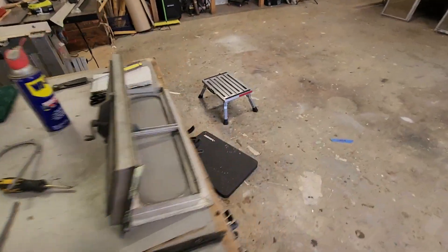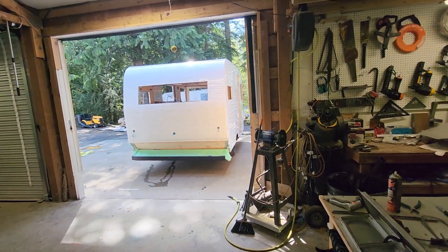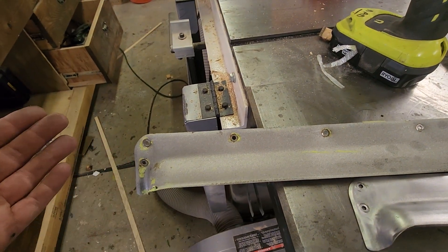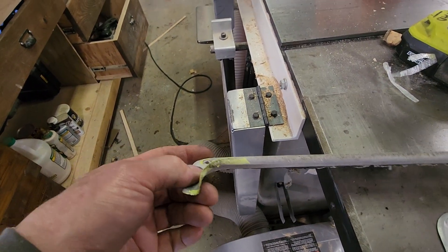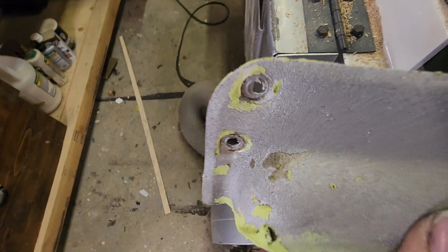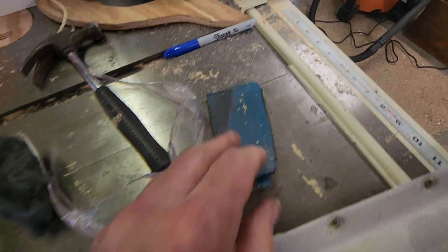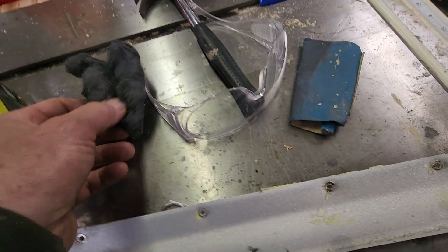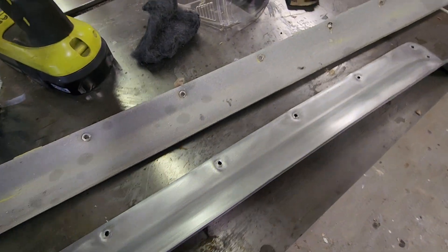The glass and everything will clean up and polish. I'm not going to replace the bumpers because they're old but still intact. For cleaning up the metal on the '62 Aristocrat — I'll do a before-and-after video once it's done — it was media blasted with a light media blast. I decided the metal had too many holes so I got all-new metal, but I'm keeping the original eyebrows. The blasting did scuff them up a bit and I thought I'd ruined it, but I was able to polish it up with just a tiny bit of elbow grease using a little 180 sandpaper to re-smooth it.